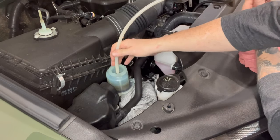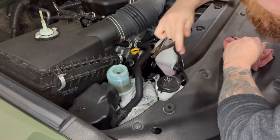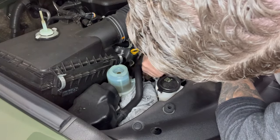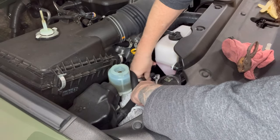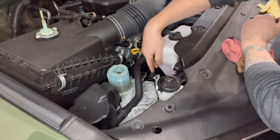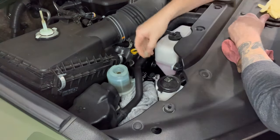Keep moving the tube about and try to get as much as you possibly can. Once your reservoir is empty, grab yourself a pair of pliers and the very top hose, which is your return line. You're going to remove the clamp and work it down. Once the clamp is down, use a twisting motion and pulling down — they usually are pretty easy to remove. Go ahead and remove your return line like so. Once you've done that, what you want to do is cap the return line with something that looks similar to that. There are all sorts of variations you can do this job — whichever one you find suitable, go ahead and do that.